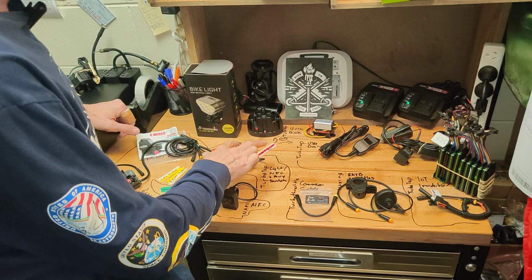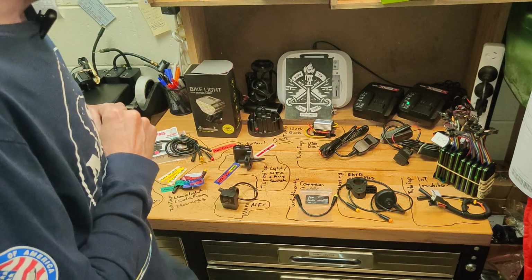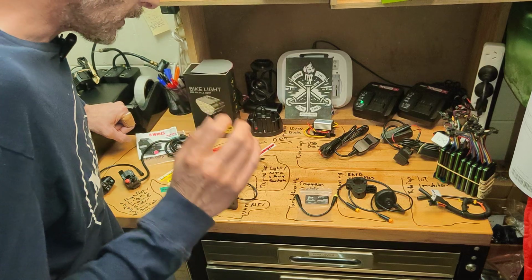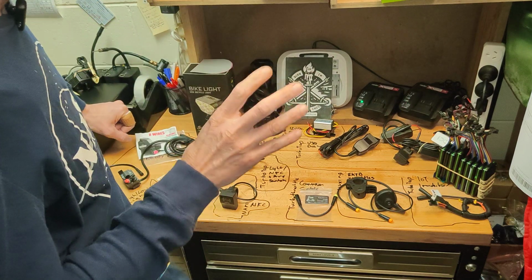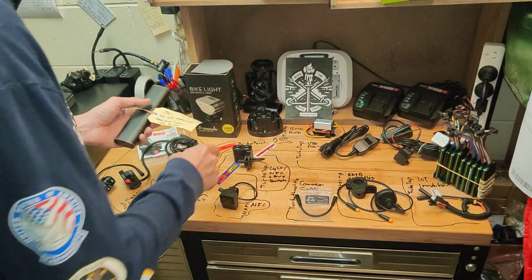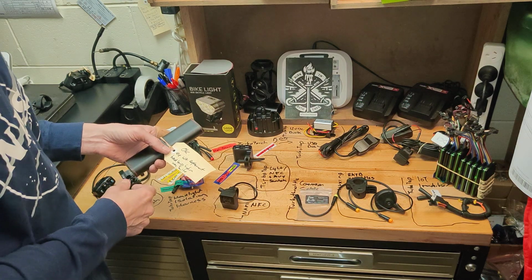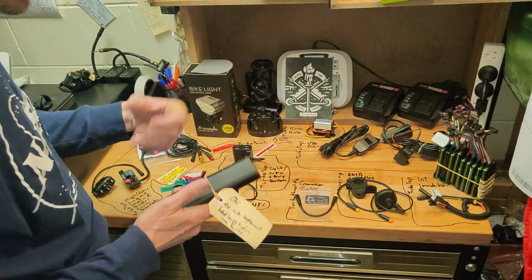So that's where you come back to the two switches and two auxiliary outs, one that's power on based and one that's actually always on. The always on one is the one you might want to have on when your scooter's off, when you're charging. So when your scooter's charging, you've got the switch on, it'll charge your external batteries. Then once it's charged, press the button here and the buck converter turns off, so it's not drawing any power. Then your headlight's running off your external battery, not the internal battery.